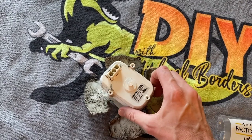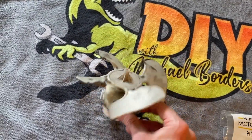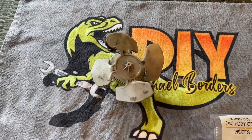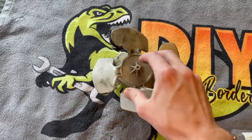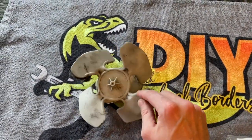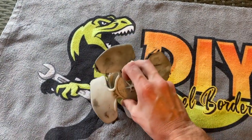This is the internal part — here is your motor, and it secures itself to a bracket or brace inside your refrigerator. The fan itself faces your compressor, and the second your compressor turns on to cool your refrigerator and freezer, the motor of the condenser turns on and spins these blades at a very fast rate.